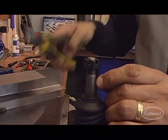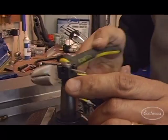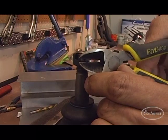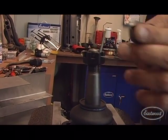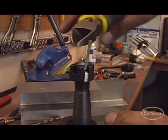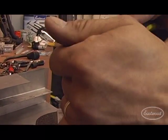Now when you install a cotter pin, it can only go one way — install it straight up. Take your side cutters, bring it up, trim this one here. This piece here — you want no lower than the end of your castle nut, right down there. When you trim it, just simply hold your finger over here. That side's folded down like that. This side folds flat — one half diameter of the stud. Just roll that right over.